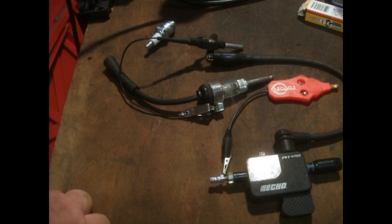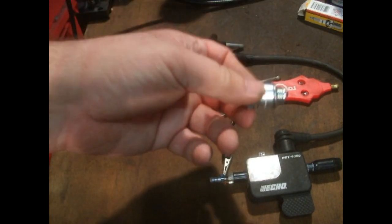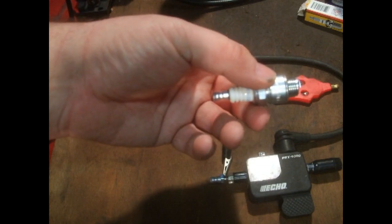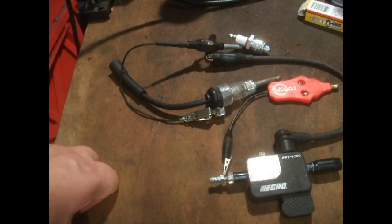Hope that helps you. I know I'm trying to get through it quickly. Don't bother wasting your time putting the plug on the engine — yeah, you've got a spark, but it doesn't mean nothing. Hopefully you understand that. With these testers, you're looking for blue, violet, or white — and orange, red, or yellow means a weak spark. Have fun, and I'll see you next time. Bye for now.